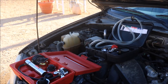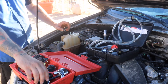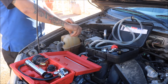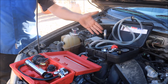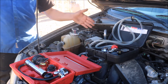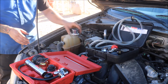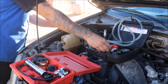Let's go hook it up. The same rule applies as with the coolant pressure tester — find the adapter that best works for you from your coolant pressure test kit in order to hook up the Venturi bleeder. This is a pretty universal kit — I believe Stant makes it for Snap-on, and Stant or Mastercool make the Venturi bleeder and other pressure test kits. Both kits are universal — doesn't have to be Matco or Snap-on. Either one can be from either company and they'll both work with each other.